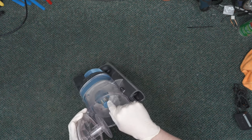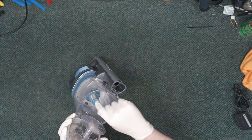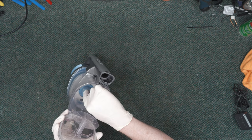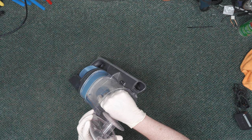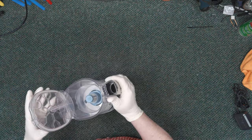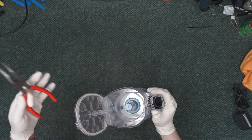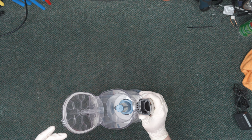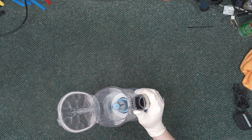The second thing is your mesh grate right here — this is a filter prior to your motor, your first stage of filtration to get coarse materials out. This needs to remain clean, so check it every time you dump the cup. You'll need to go in and pick dirt out because it's not removable. You can use your fingers, needle nose pliers, tweezers — whatever works. A dry toothbrush is very good at cleaning those grates; it'll lift and pull the dirt away.